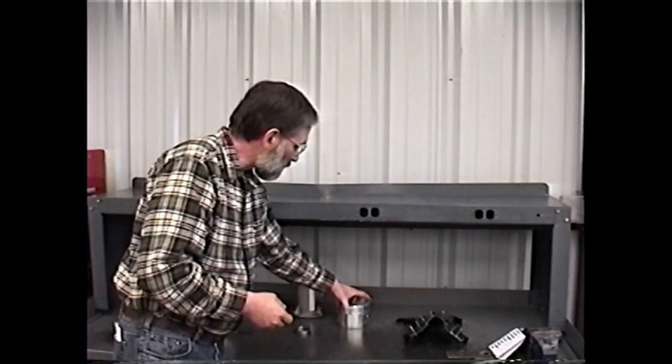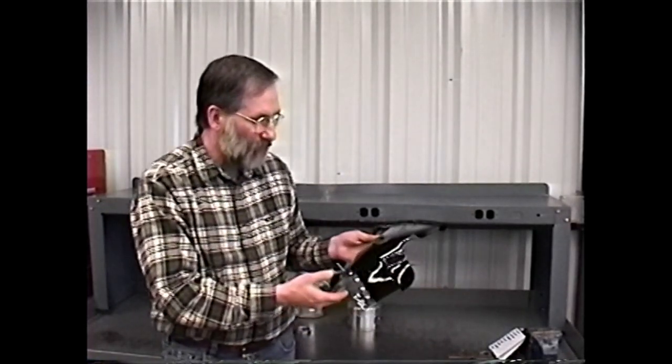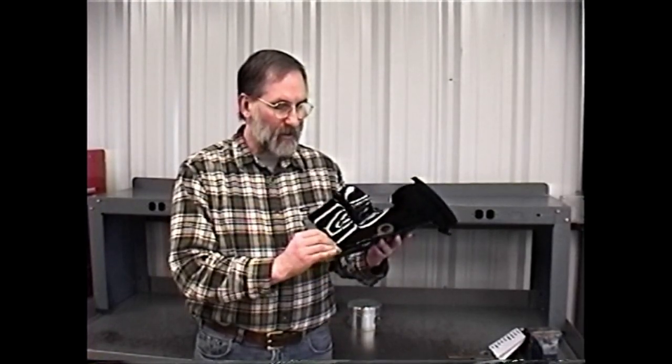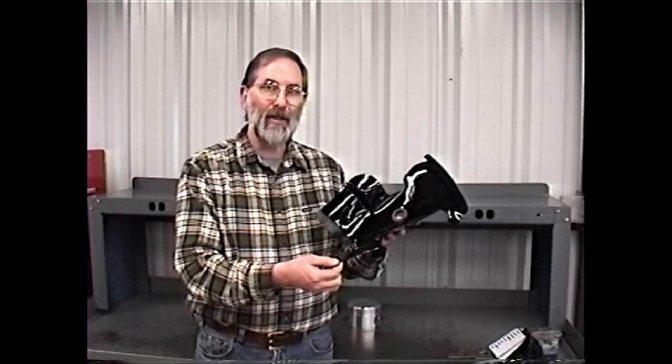Another improvement was an alternate piston that we had approved about 10 years ago for the Jacobs engine, and it has done very well. The intake pipe drain, which automatically drains any oil that's in the intake pipe, we've already discussed. Another improvement that we just got approved is the modification of the engine baffles, and this mod is good for any of the Jacobs engines. This is a Cessna 195 baffle that we're in the process of modifying — you can see the rivets haven't been pulled yet — and the modification consists of trimming the bottom one inch off the baffle and riveting in its place a piece of rubberized baffle seal.